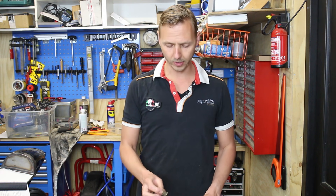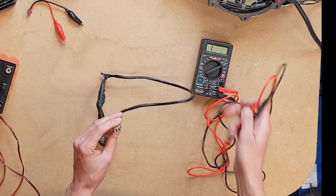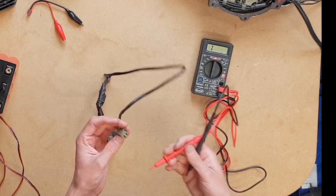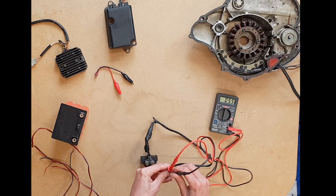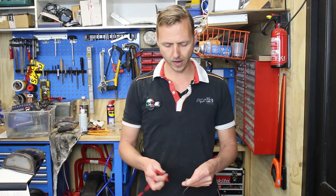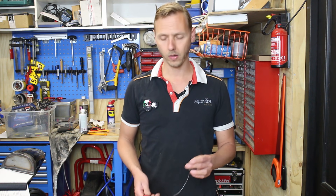There are several ways to test it. First, let's test if this has a closed circuit. I put my voltmeter again on ohms. There won't be a lot of resistance here because this is just not more than a wire. So this should be wired — let's see. That's normal: four ohms, which is a really low resistance — great. So I have a good circuit here. The wire is okay, everything runs through. That's good.